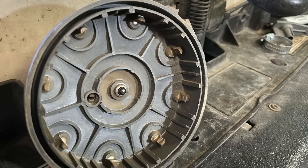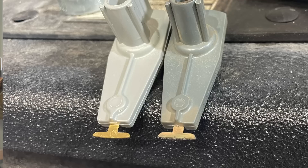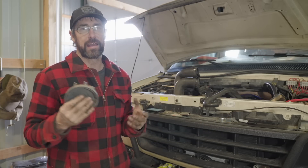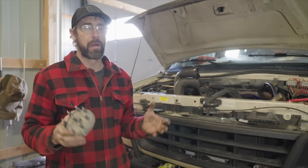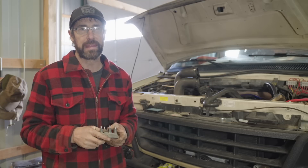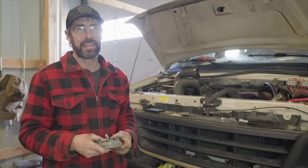Looking at the old cap, I can see some corrosive buildup on all the little electrodes inside — not a crazy amount, but definitely enough to affect performance. And looking at the rotor, there's a lot of corrosion and it's been eaten away pretty bad. So I definitely think we're going to see a performance improvement in Sasquatch. Doing tune-ups on older vehicles really can bring them back alive, so don't underestimate how much a tune-up can help. If it's been a while, might be worth getting it done. If you enjoy seeing these DIY maintenance items on Sasquatch, leave a comment below and we'll see you again outside.